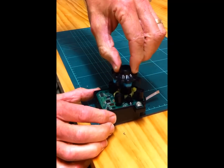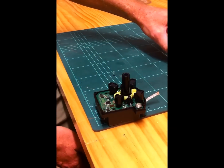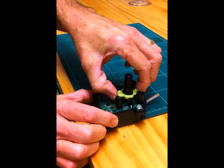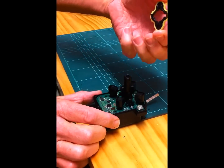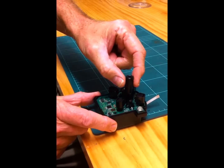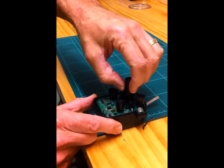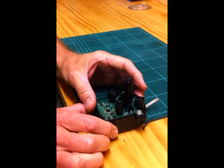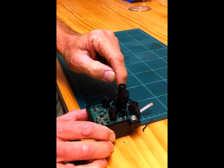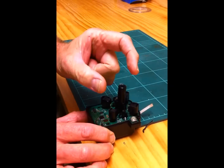What we do is we lift the top section off, and then we lift off this fitting here. You can see the shaft. The shaft that breaks is actually inside this fitting here. The next thing we have to do is we have to remove all of these little posts here — that's where the switches are held when you move the control left, right, up, down.